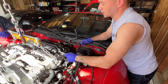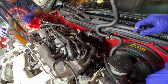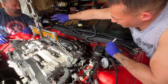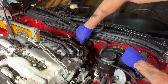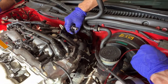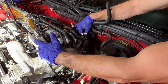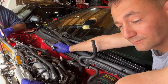One thing to point out: if you're going to pull this motor while leaving the engine wire harness on, there are brackets that hold the wire harness up against the firewall. Three of them you can get to while the motor is still in — there's one on the very far right, one a little bit closer in from the right, and one on the very far left. The rest you're probably not going to be able to get to. So I recommend if you're going to install the engine with the harness still on it, set the motor a little bit far forward with no motor mounts on it, connect those inner brackets that hold the harness in, and then when you settle it all the way in, get the one on the very far left, the one on the very far right, and the one second from the far right.